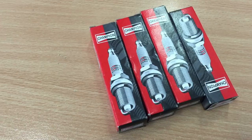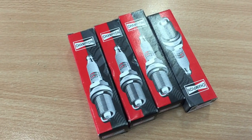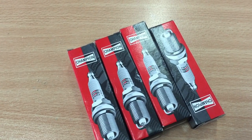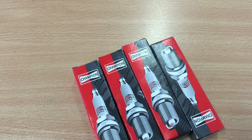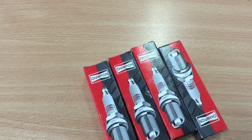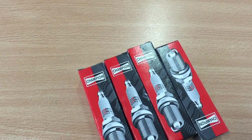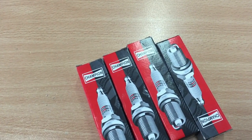Spark plugs are a very crucial part of your car. If your spark plugs are busted or not working properly, you can have a majority of things going wrong. First could be misfiring. Second, your fuel economy will drop dramatically — so if you're getting 100 km's out of 10 liters, it might go to 90 or maybe 80 km's per 10 liters. The other thing is power — the car would not be as responsive as it's supposed to be, like it's not responding to you right away.